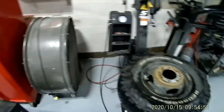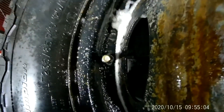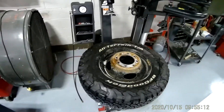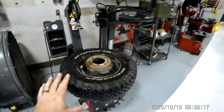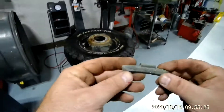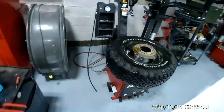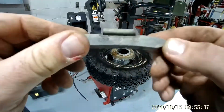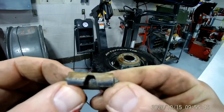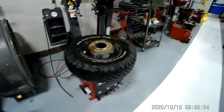Before I do anything else, I'm going to spray it again to make sure it's not leaking. As you can tell, it's not leaking air, so this thing should be fixed. Thanks for watching. My next step is to balance the tire because I removed the weights. Tires are balanced using these clip-on or stick-on weights, usually measured in ounces or grams. This one is 1.75 — one and three quarter ounce — and this one right here is 0.5, which is a half ounce. This is for a steel rim; you can tell by the shape of how it fits on there. We'll talk more about that in another video.